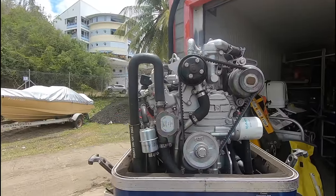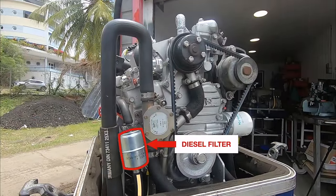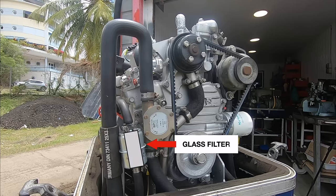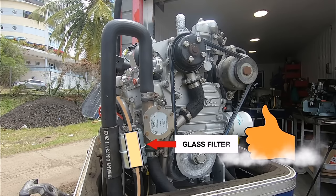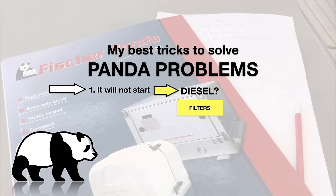No matter how crazy it sounds, this is the first thing you should replace — with two new filters. One better yet much cheaper and longer lasting with replacement filters. And right here you place a dirt cheap glass filter without the filter element inside — only to have the reservoir, but also easy visual confirmation of whether it's getting diesel or not. Not only will this eliminate one of the most frequent problems, it makes the next problem easier to see and fix as well.